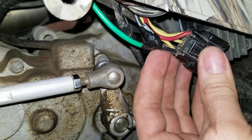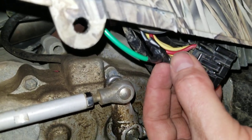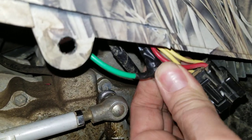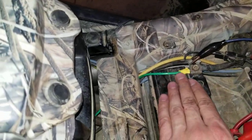Find the black wire with a white stripe on it, strip the insulation off with a knife — don't cut the wire in two. I used a 12 gauge ground wire here, soldered it on, made a good connection there, then ran it up to the negative terminal on the battery.